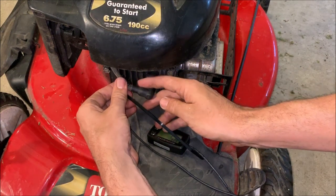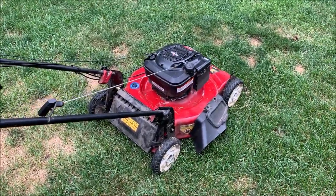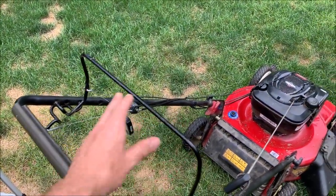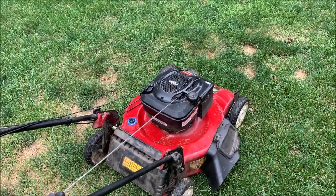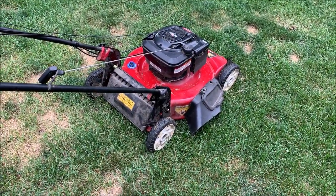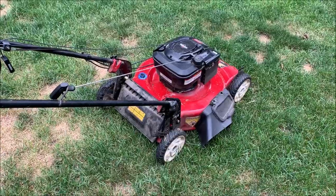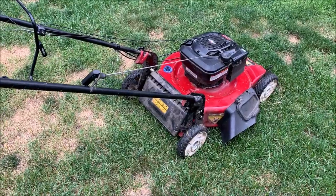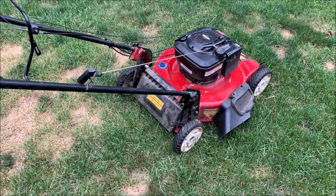Okay, so I'm about to start this engine. I won't be able to say much while it's running, but I'm going to start it, tie this down so the engine keeps running, check the tach, and make adjustments as needed. For this particular mower I don't have the exact RPM specs, but I think 3200 would probably be a safe number. I know this engine can handle up to around 3600, but on other similar push mowers I've put a tach on they come in around 3200 and that speed sounds pretty good, so I'm going to aim for that.